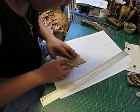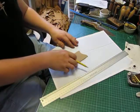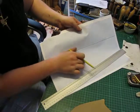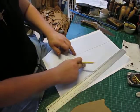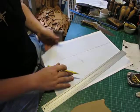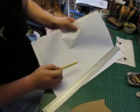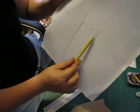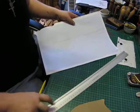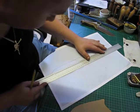because this is important to get right as well. If you're feathering it into the inside, it's got to be the right length, width across. It's got to be the right width across, otherwise it'll be too big and it'll stick out the sides, or too thin, even worse, which you could trim down. You'll cut this too thin, and when you come to fold it over, it'll come into this part here, and obviously then you're going to have a bit missing inside the welt. You don't want that. Right. Let's push that over. Okay.